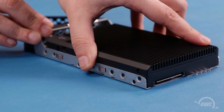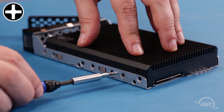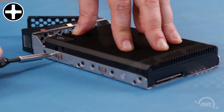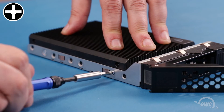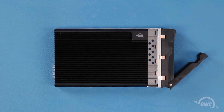Adjust the drive until the drive's mounting holes are aligned with the nearest set of holes in the tray. Secure the drive to the tray using four of the flat-topped wide-threaded screws included with the Flex 1U4, two on each side. Your three-and-a-half inch drive and tray are now ready to install in the Flex 1U4.